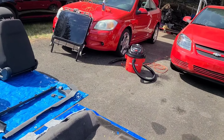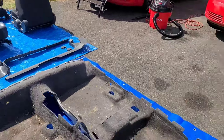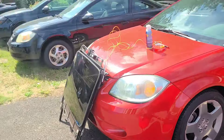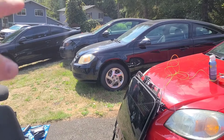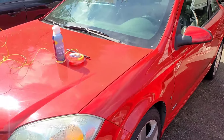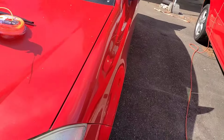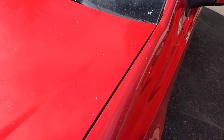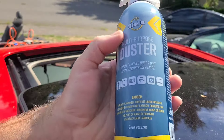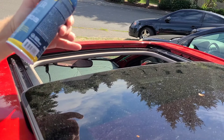It pretty much left a terrible smell in the car, so I pulled the entire interior out and went through cleaning it. The smell is gone, and I'm going to use new carpet from my parts car. But if she had spent 15 minutes twice a year to maintain the sunroof, it probably would have never leaked. First thing I'm going to use is the electronics duster — this will help spray out the tracks and the drain holes.